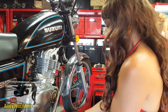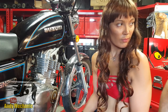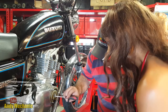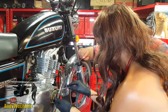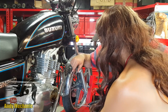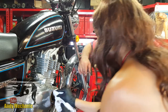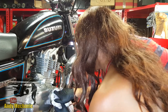Right, one oil filter - we need a little flat screwdriver. There you go, give your hands a bit of a clean. We can just pop that filter out. Make a note of which way around the filter goes - it's blanked off to the outside, there's a little one-way valve there. Give it a little lever and you can take that out. Nice! Pop that in the oil for now because it's old and it's going - it's time for the bin. Get the rag and give inside where the oil filter sits a bit of a clean.